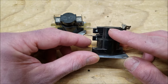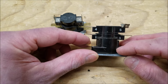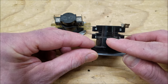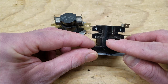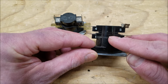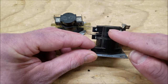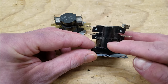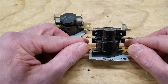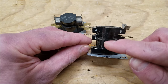That rod normally keeps the contacts between 5 and 4, and between 3 and 1, open. When the pan gets heated up and the thermodisc flexes, the rod moves down along with the middle of the thermodisc and it closes the contacts between 3 and 1, and then also closes the contacts between 5 and 4. The two rods are slightly offset from each other, so there are time differences — 1 to 3 has a different time requirement than 4 to 5 because of the position of the two rods inside.